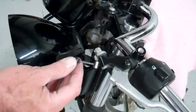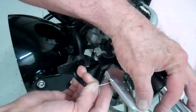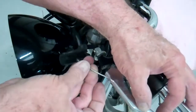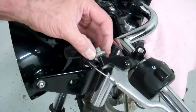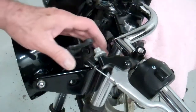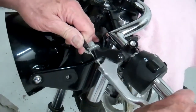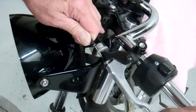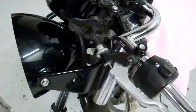Now we can go ahead and hook our clutch back up. Pull the lever over like this and put the little keeper in there at the bottom. With the barrel adjuster all the way and the slots toward the front, we just reverse the process of how we got it out. Basically, push that on there, push the lever in, and then pull on the cable. You may have to do it a couple of times, and that'll go right in there.